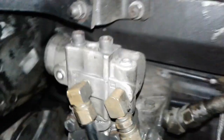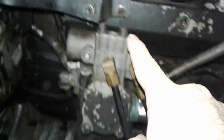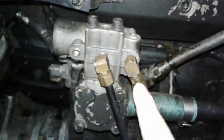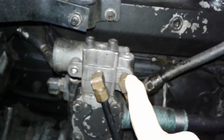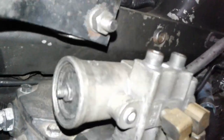So check this out — this is an air compressor governor. Every truck has one. This one's mounted right here. I wanted to show this type because most people have this type. Mine is down here where the filter is next to it, but it's exactly the same — aluminum, two allen head screws. Take these lines off, take these brass fittings out, and use thread tape or a thread sealer.